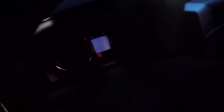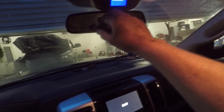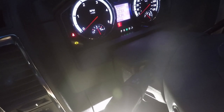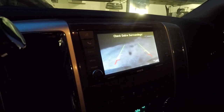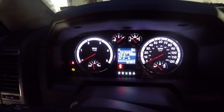Here goes nothing. That didn't seem to pan out. I wonder if I need to reset the Minimax. Look at that — got just reverse once I cleared the codes. So that proves that. Now when I ground this alligator clip we should see neutral. Look at that — neutral. Reverse. Neutral. Reverse. Boys and girls, I think that's a good to go. I think we got her figured out. Just a little ground action and everything changes.